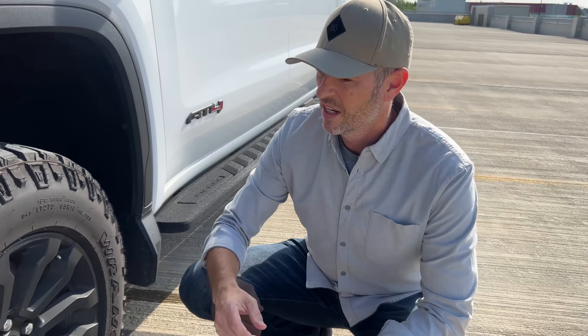License plate LEDs — the pros: they're super bright, not that amber incandescent bulb look that looks really cheap. The cons: I've heard from other people that in some cases certain LED bulbs in here can make the backup camera have a bit of a hue or halo around it, though I haven't experienced that. Also, LEDs sometimes just don't last, but these were super cheap — you get a 10 or 12 pack for not that much money and they're very easy to replace.